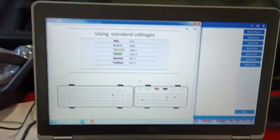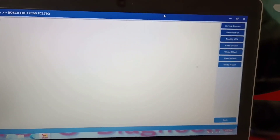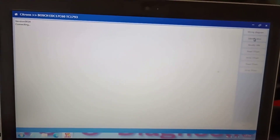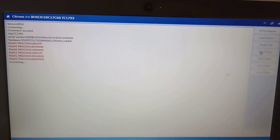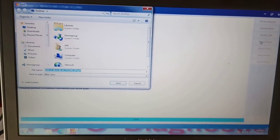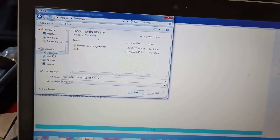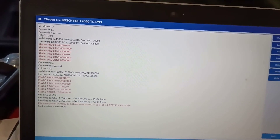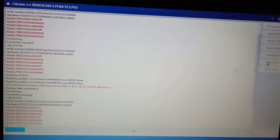I made the connection according to the diagram and now we will close and identify the ECU. We will read the EEPROM, make a backup, and also read the pflash — the flash data from the EEPROM. This one goes fast. If you notice, it has already started.